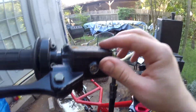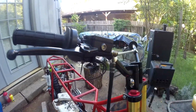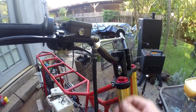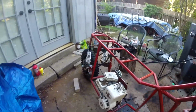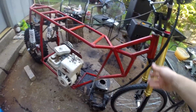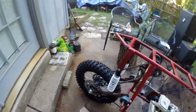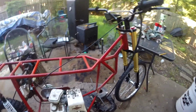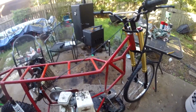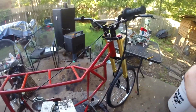So yeah, the next thing I'm going to get set doing, because that didn't take very long, is installing the new brake cable. So basically, these got rusty pretty bad. Good thing I have 50 of them. But anyway, just unbolt this banjo bolt, put the new one on. Get rid of this nasty nonsense that didn't work. And do the same on this side, and then fill it up and bleed it, and then zip tie it in the right position. So yeah.